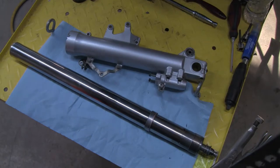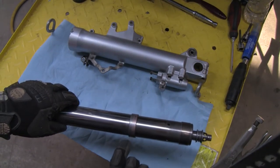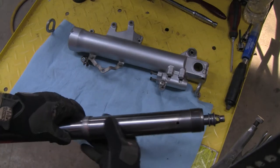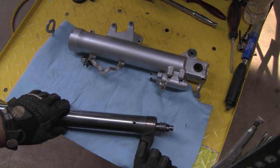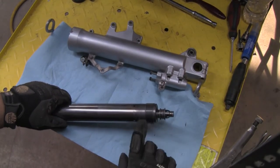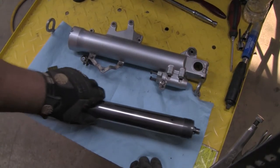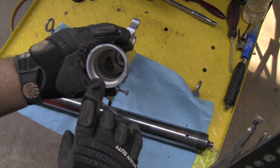These bushings that I found have a bit more wear on them. The outside of this bushing, as I showed you in the last one, there's less of the copper showing and more steel or whatever the metal is. Here is this bushing and if you notice this area here is very brass looking, and that means it has wore the charcoal gray area off part of the circumference. The charcoal gray area is what moves against the lower fork tube right there.